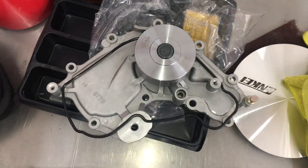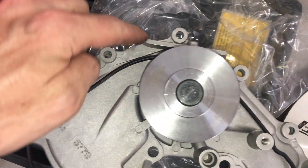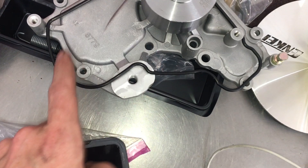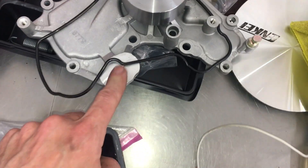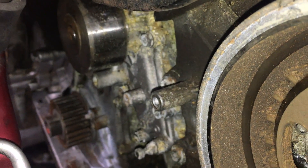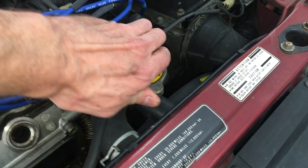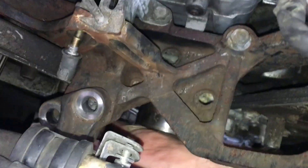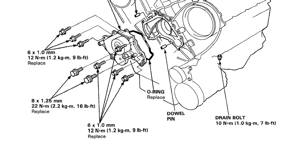Here's a look at the new water pump — 9 bolts — and this is for the tensioner. Look at all that crud on the old one from leaking coolant. It's time to drain the coolant. Crack that open — that'll help it flow a little faster. While that's draining, I'm under here loosening all the water pump bolts. Dropping 10mm sockets — there's really no point in trying to film this part, not like there's any way to see what I'm doing. I can't even see some of these bolts, just going by feel.